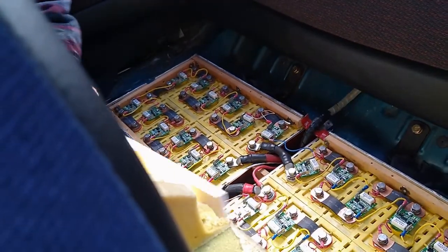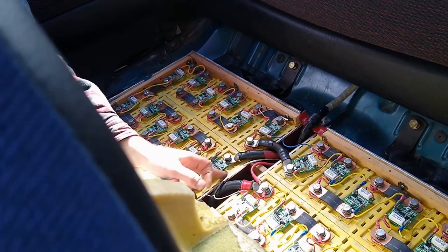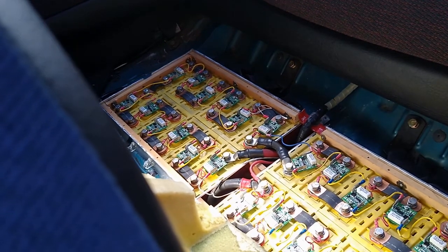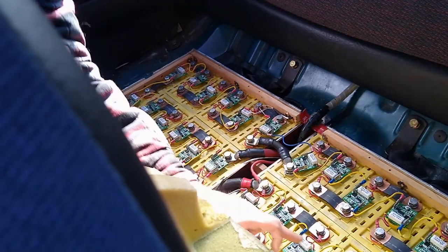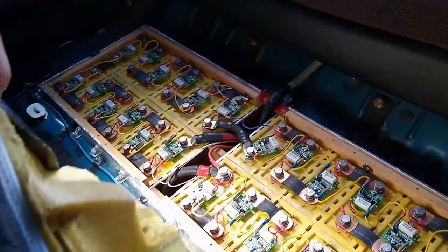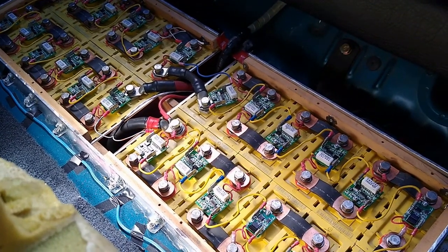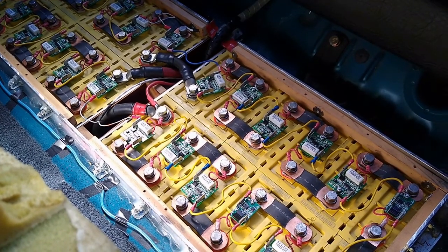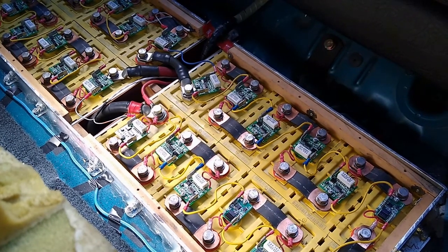So they're a little old. These are 100 amp hour individual cells — I think they're done by Thunder Sky. They're old; they still work, but they just don't have the capacity anymore. These little chips are an older style BMS system called a mini BMS. They monitor individual cells and that information is sent to the main BMS unit, which is actually under the hood. It's a very small, very basic unit — nothing like the Orion systems that you and I have been playing with recently.